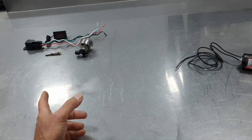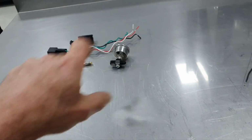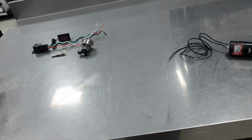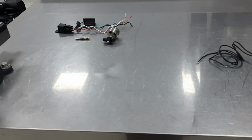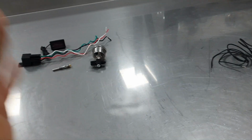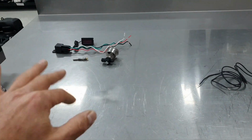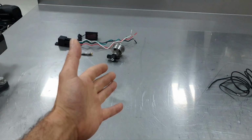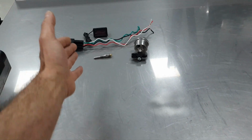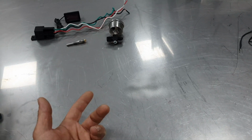Because all of these parts, okay, obviously the solenoids you're not gonna remove, but the tank with a bracket inside and these things have to be removable, to take it out, dress the car as it was, and use it as a daily. So it is a little bit complicated. If it was purely for a dragster, only for racing use, that means you are using it only on the racetrack and then parking it in your house, then it's gonna be much easier because it's gonna be fixed inside. The only thing that has to be removable is the tank to recharge again. The relays and the fuses have to be easily accessible just in case you need to do something. All right, but not in this case.